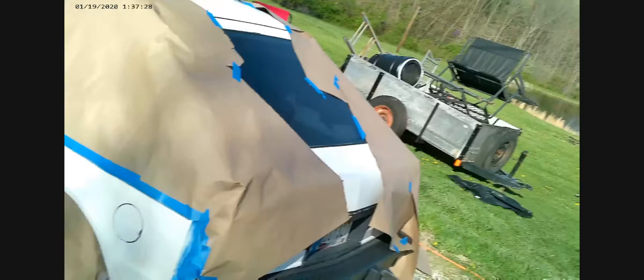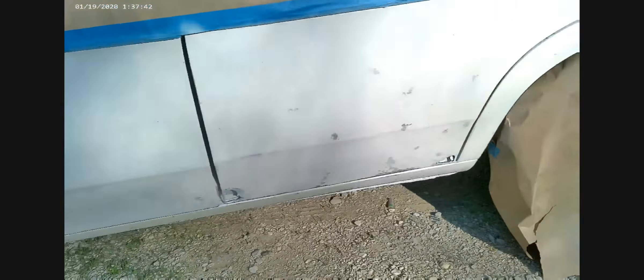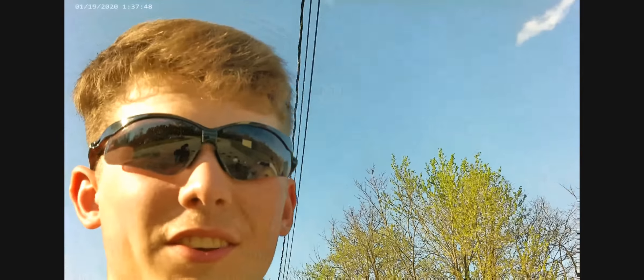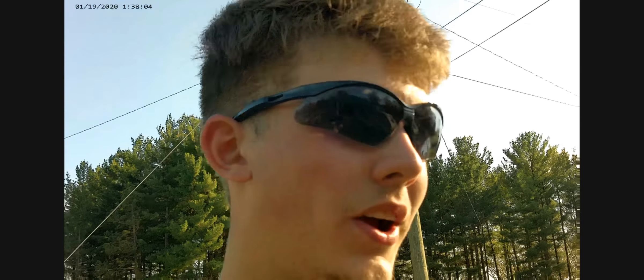As you can see, a few hours have went by and I've been sanding and sanding and sanding. I just put three coats of primer on here. You can still see some of those rust holes - I'm not just going to leave those like that and that fender part right there. I'm waiting to find a scrap Chevette that I can steal corners of doors and fenders off of. This side I've got about two coats of primer on after sanding everything down - it's almost mostly all white again instead of gray. I'm going to put another coat of primer on here and start painting.